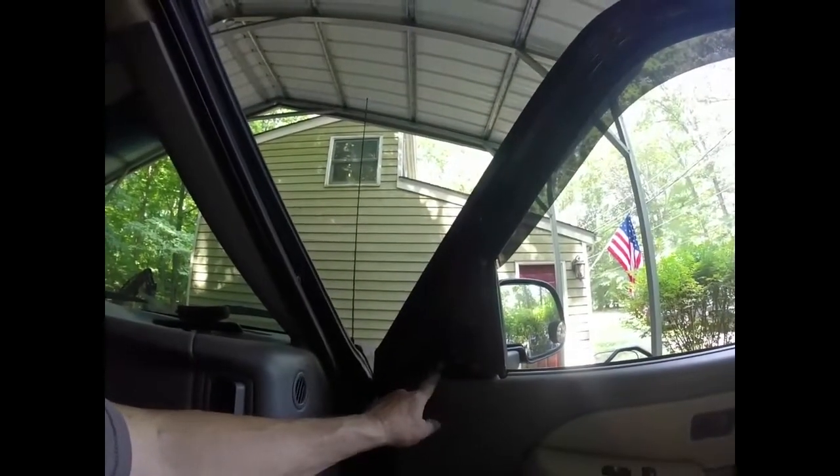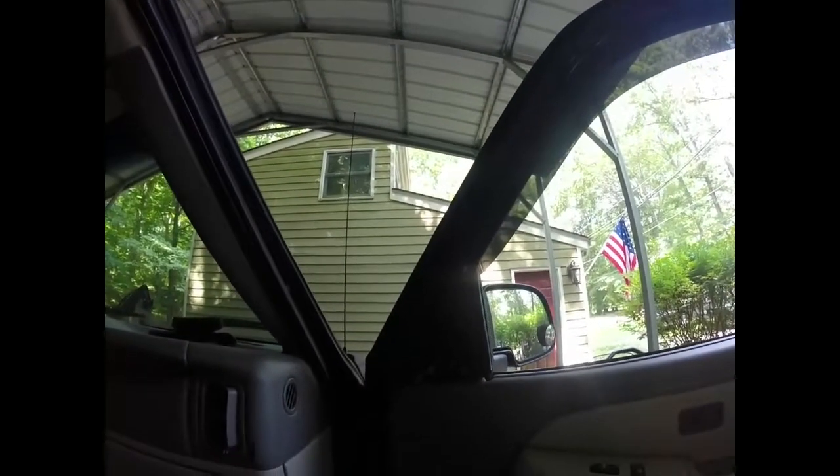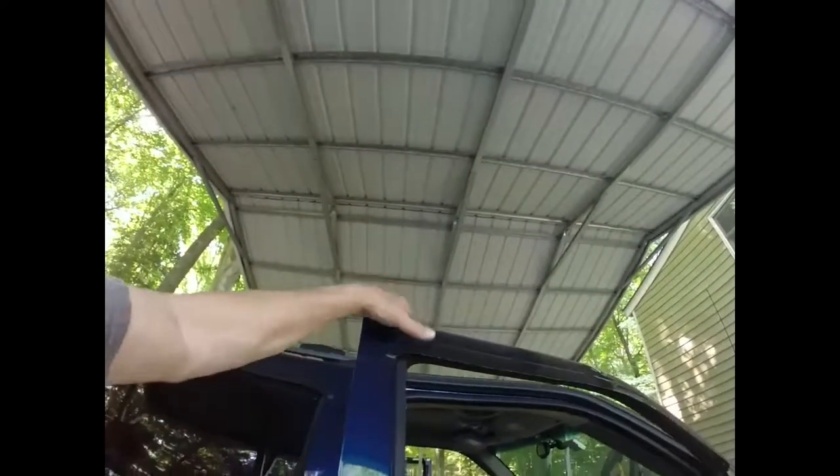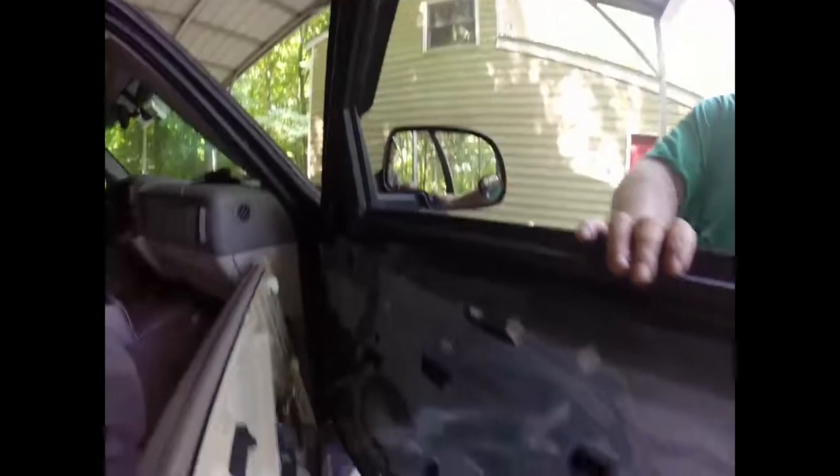The mirror's got three bolts — those are 10s also. There's a little clip down here, and that'll take the mirror off. Unfortunately, the only thing we're not going to be able to save is the ABS rain shield, which is coming off anyway, so no big deal. Pretty much it's not pull out, it's push up — push up on the door panel.